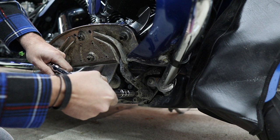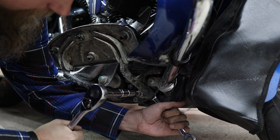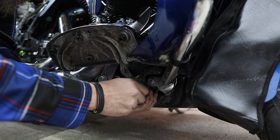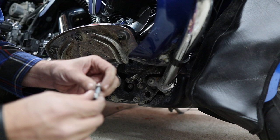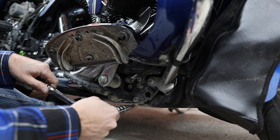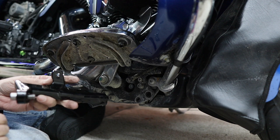You want to use the nine-sixteenths box end wrench on the nut on the back. Once it's loose it can just be undone by hand, then you can pull this out. You'll reuse the pivot pin but you will not reuse this bracket. Now we need to remove this bolt — you will not reuse this one either. Now we're going to install the Ciro mount using that pin we took out originally. I'm going to mount it to the floorboard first.